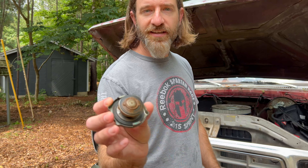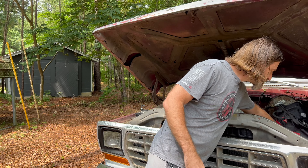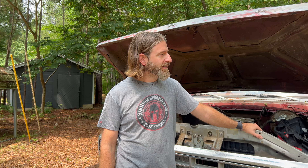When I went to check it, the fluid was just brown and almost muddy, with all this crud all through it. I'm guessing all that rust and sediment was just rock solid in there, so when I was flushing it, it really wasn't doing anything. Then after months of driving it just broke free and started circulating through.